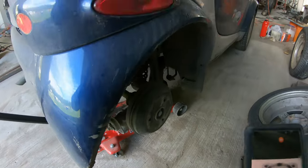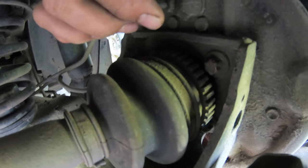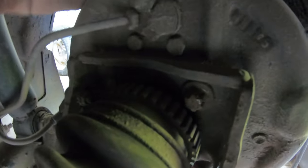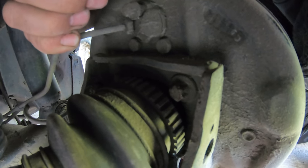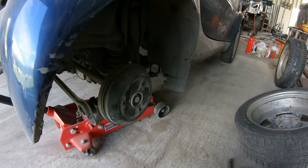If you really insist on adjusting your camber, you have to pull out the CV axle first. Then you have four bolts — two at the top and two at the bottom. Once the CV axle is out, loosen the bolts on the bottom or top depending on which way you want to adjust. Take those bolts out, pry it out a little bit, and shove your really thin washers in there. Remember: a tiny little washer will make a big difference, so make sure both washers are the same size. Then bolt it back together and hopefully your camber will be close.